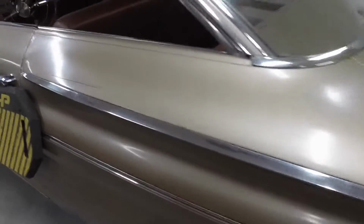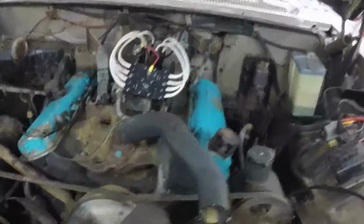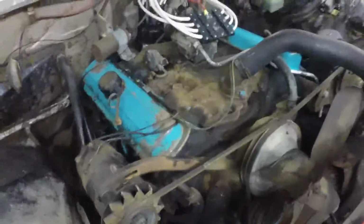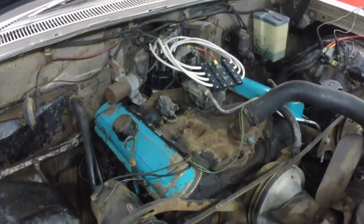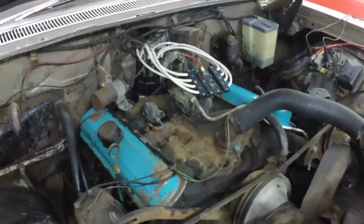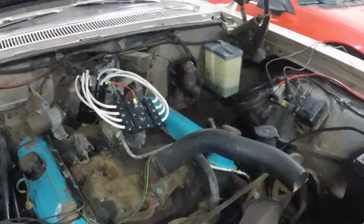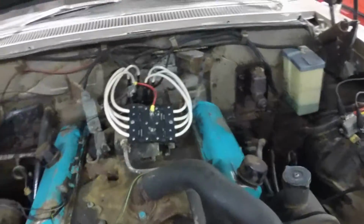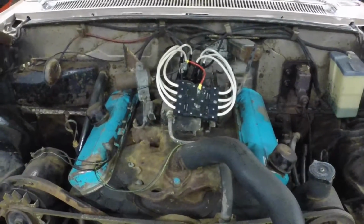It's clean on the inside. The fuel lines on this car are not rusted out, so I'm just going to blow some lacquer thinner through the fuel line to clean it out, blow some compressed air through it. Just replace the rubber hoses and leave the fuel line on the car. When I scrape the undercoating off, it's still shiny silver. The brake lines, I'm going to replace everything in the brake system. But the fuel system, it doesn't need anything. And we do have good spark, as you saw earlier. So the car is ready to rebuild the carburetor and start.